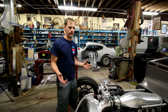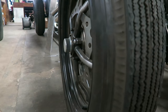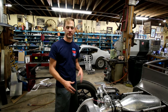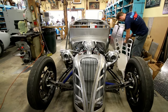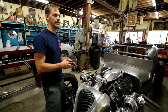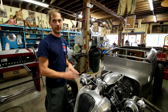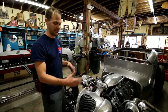Let's take a walk around. On the hot rods I've built, I've done a torsion bar setup in the front, and this one's no different. That lets you do a lot of different stuff with the suspension instead of having that lateral leaf that's sort of in the way a lot of times. Under the grill shell there's an intercooler and radiator. I've seen other people do turbo setups on hot rods where the intercooler looks awkward and misplaced and you can't fit a grill shell around it. I didn't want that — I wanted to make sure it had that traditional grill shell.